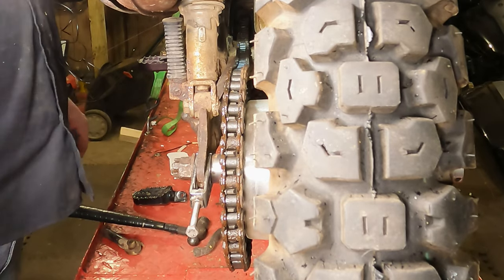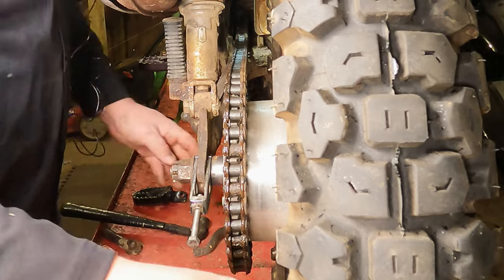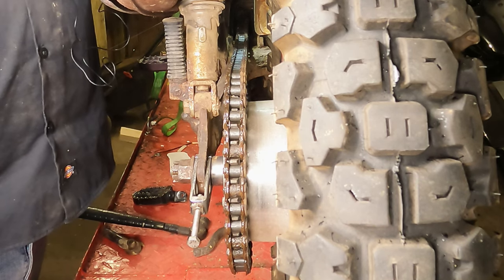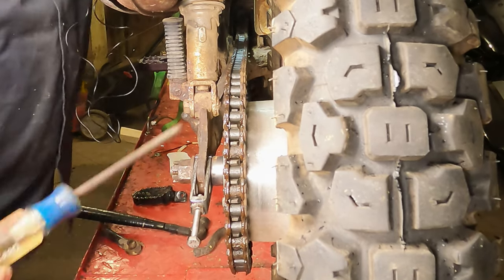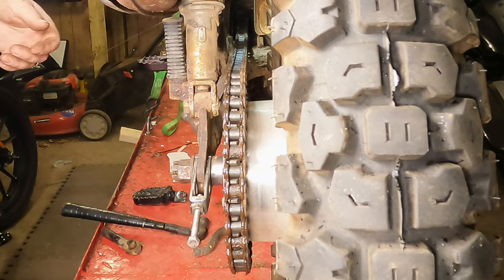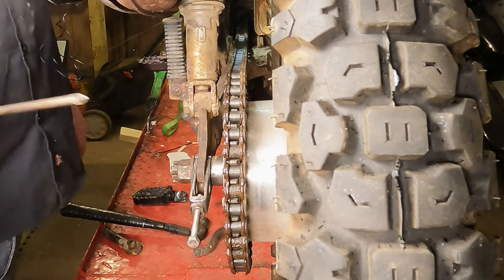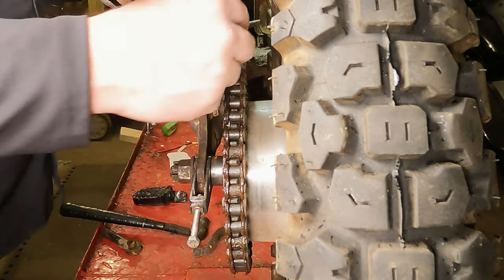So what we're going to do to align this thing is first set our alignment — we're going to crank our axle adjusters in until it's aligned, and then set our tension. You want to set your alignment first because as you adjust alignment, that can affect actual chain tension. Right here it's pretty close; there's not really much of a bend, it's a pretty much straight shot. So we're sitting pretty good there. What I'll be looking at the entire time is looking up this chain to see if I have that angle, or if the top of the chain looks like a straight shot going all the way forward.